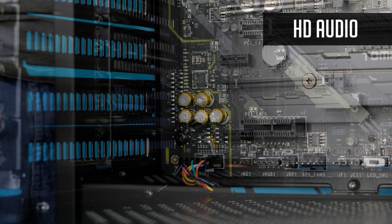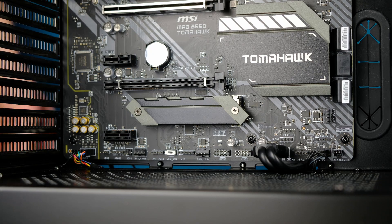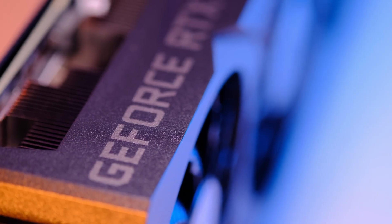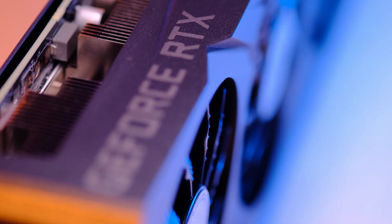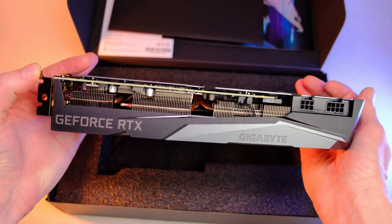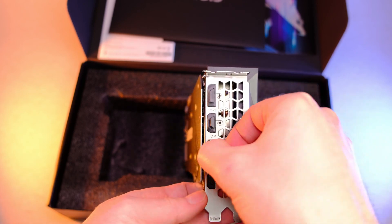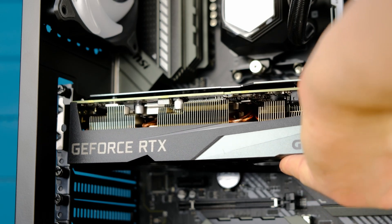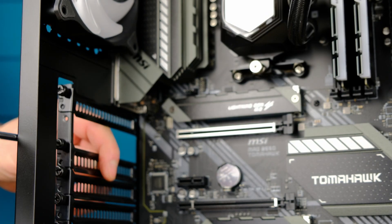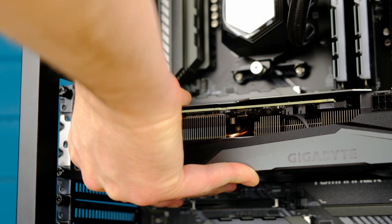Let's do some wiring. It's much easier to connect the PC case front IO panel before you add in the video card. It's finally time to check our GPU — this is the Gigabyte RTX 3070 Gaming OC. It's one of the better-priced models, though it depends on your region and country. You might also consider the RTX 3060 Ti, as it provides even better value for money. The RTX 3070 is a better option if you need higher frame rates in 1440p and especially in 4K. Before installing the GPU, check which PCI slot covers you need to remove — in our case it's the second and third. Pull back the retention clip, slide the GPU in, and secure it with screws.